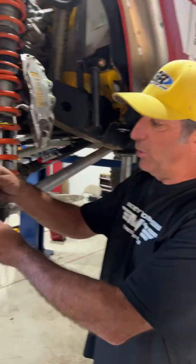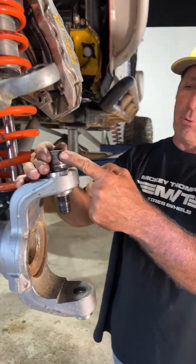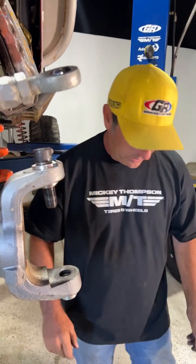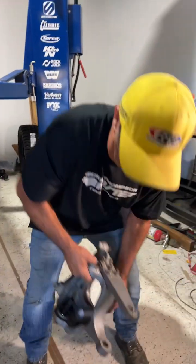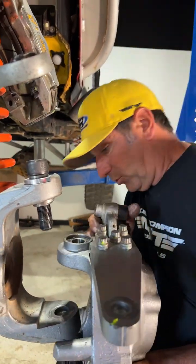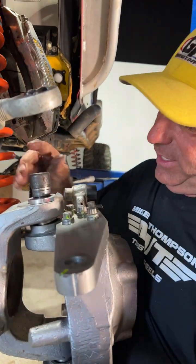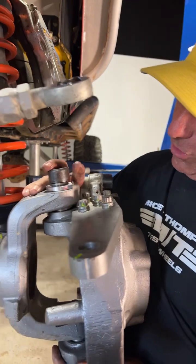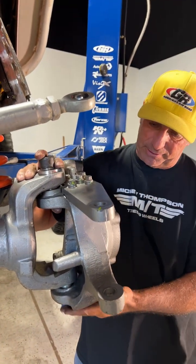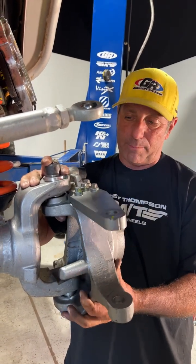One of the things that I do, I've installed the ball joint deletes, and I put brand new bolts in because they're really taking the bulk of the load, and then I check the knuckle by putting this whole thing back together. So it goes like so. This slides up inside, and you have to make sure that all of this comes together and clamps on the Uniball inside. And then we make sure that the preload's right, that we've got the right amount of steering